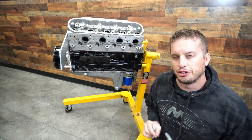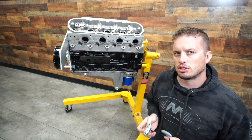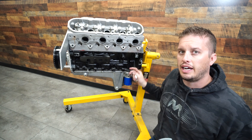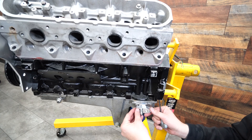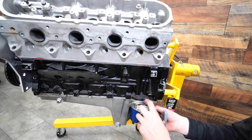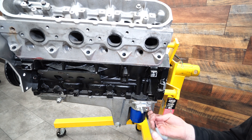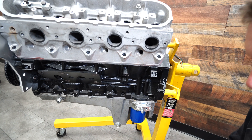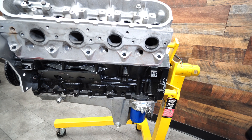If you're in a pinch, there's a factory piece that comes on there and you can machine it out and weld an aluminum bung to it, but by the time you do that it's really not worth the time compared to buying this thing for less than twenty dollars from us. If you can't find your factory gasket, you can use a little bit of RTV — but use very little, otherwise it'll smash into those ports and block oil passage for your turbo, which is a bad thing. I made a video about not using RTV for drains. Whenever possible, use a factory gasket — you can get them at a local parts store.